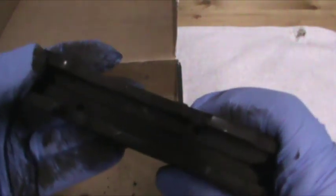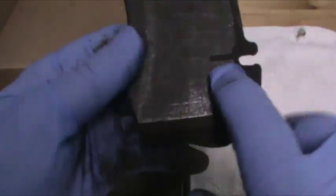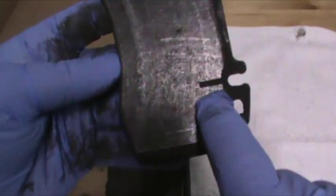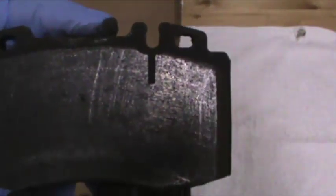You always want to try to have even wear on your pads, but that isn't always the case. I've cleaned rotors and calipers and lubricated everything very carefully to make sure they'd slide or compress evenly, but that's fairly difficult to do. My main point is: if your pads have an electronic wear indicator and it alarms, you are very near the metal. If you don't want to buy new rotors and just replace the pads, do it as soon as you get that indication.